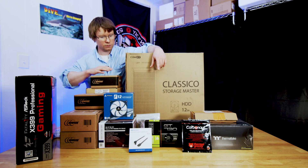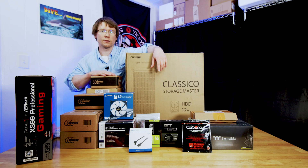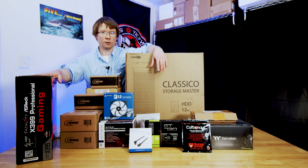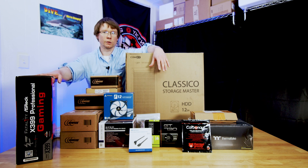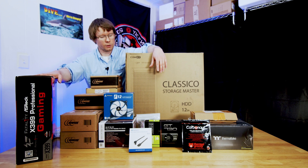We have just a little graphics card here, a GT 730. Threadrippers don't have integrated graphics, so if we want any graphics we need a card. We're going to use TrueNAS Core in this — I've never used that before. In the past I've used Ubuntu with ZFS utilities running ZFS on Ubuntu. I've heard that you can do video encoding for Plex or other things with a graphics card, so we're going to try the NVIDIA one to give that a shot.